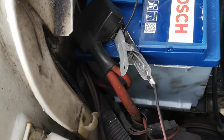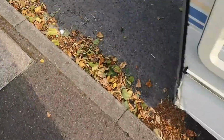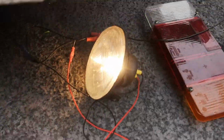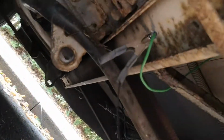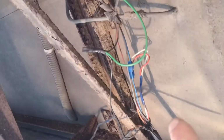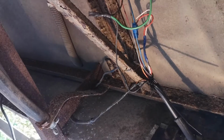Okay, to reverse think it, now put the jumper lead onto battery positive, run it round the outside, and got it connected to a portable light and connected to that same ground point, and we have, this is just a headlight unit that's acting as a test lamp, dragging a lot of power. Obviously it's going to be sort of 55 watt, and that's proving that it actually is a good grounding point. So we've got an issue in this area, so we'll dig it out and investigate.